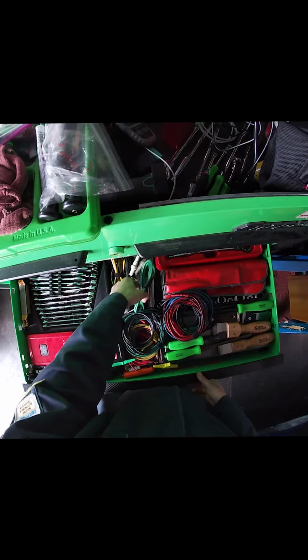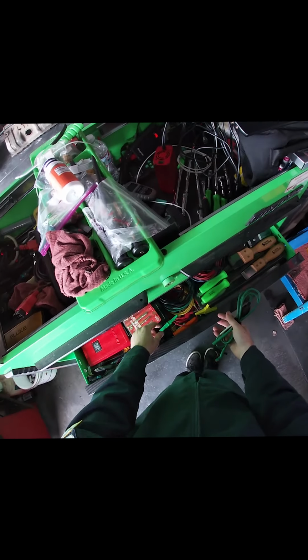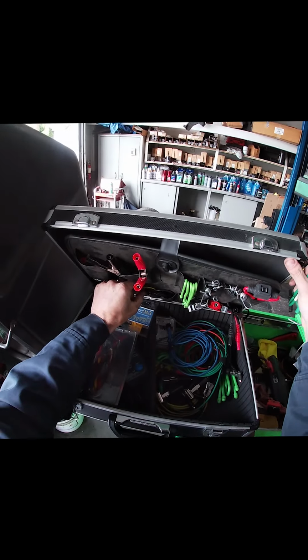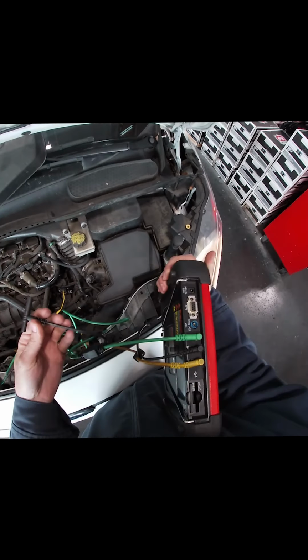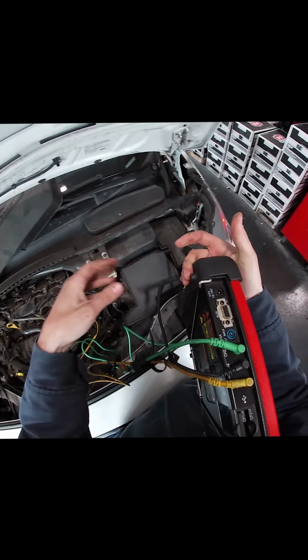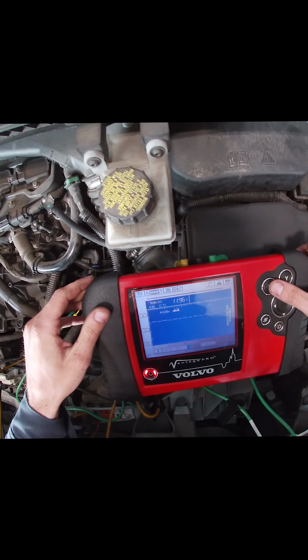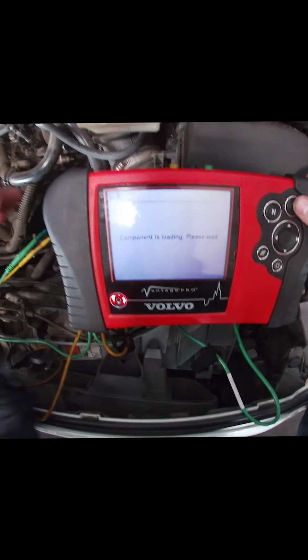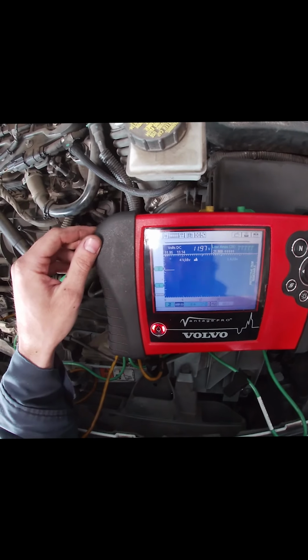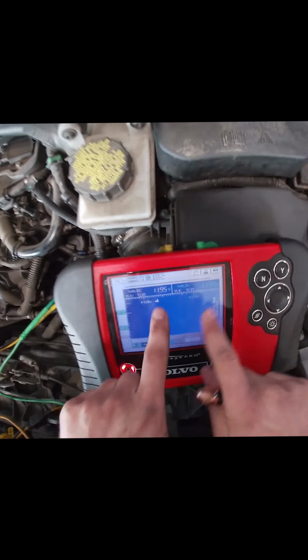So basically all I need to know now is, is it being controlled? Just be thorough. So I'll just show you the second ground. There's my second channel. What do I do with this ground? Connect it like this. Boom. So yellow is in A, this all goes to B. Make it easy, just go to dual. So we're on amps. Go to volts. So now we got, boom, right there.